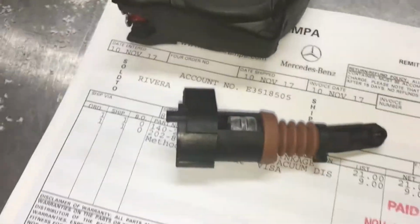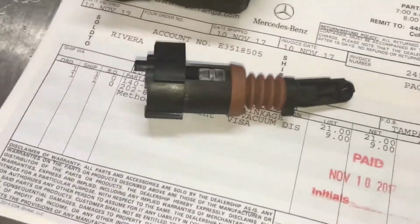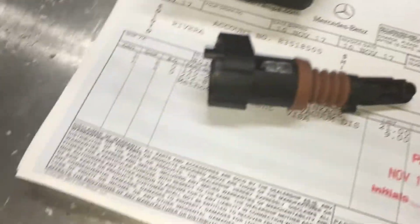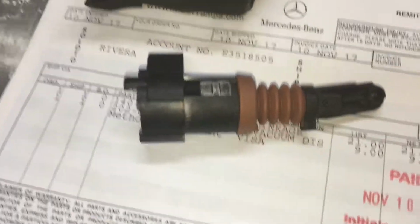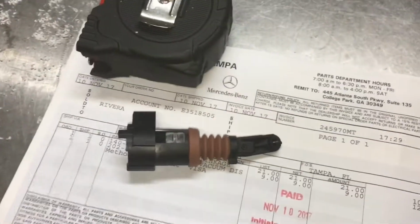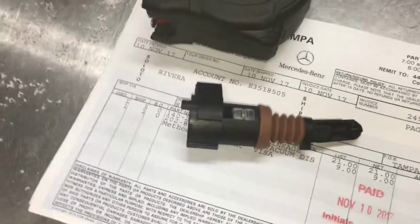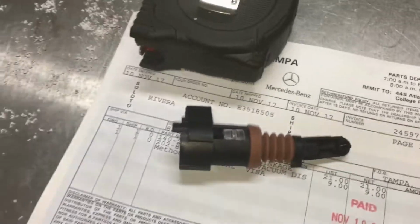It's the same process. I gotta drop the pan, and luckily I don't have to take the valve body out. So I'm lucky there. So just drop the pan. I'm gonna use the same gasket. I'm gonna use the same oil because the oil is brand new. It's only been in there for a couple of weeks, and I paid a lot of money for that oil. So I'm not gonna even bother replacing it. It's just gonna go into a clean bucket, and then I'm gonna strain it before I put it back in again. And maybe I'd have to add about 2 more liters of oil.